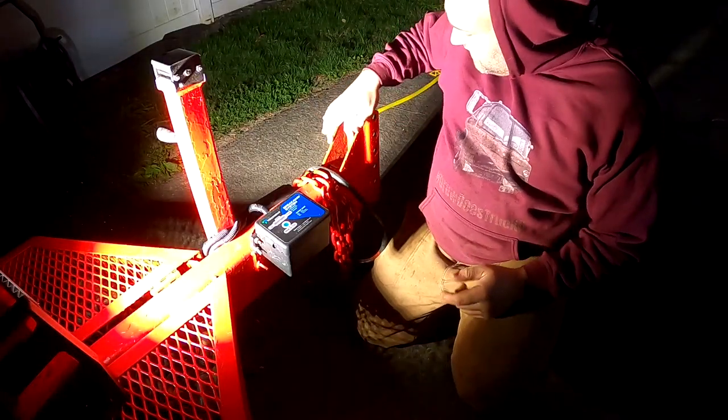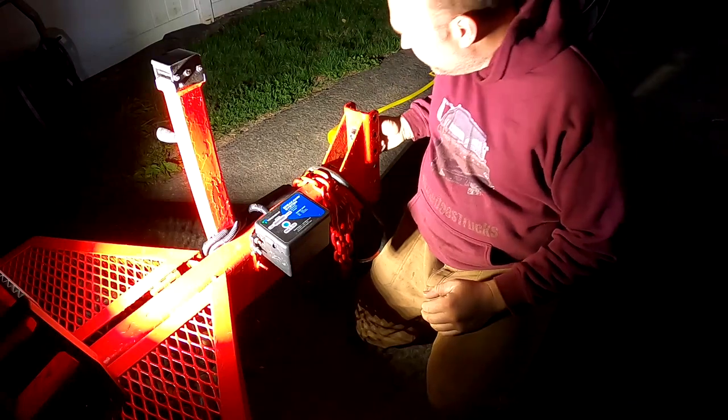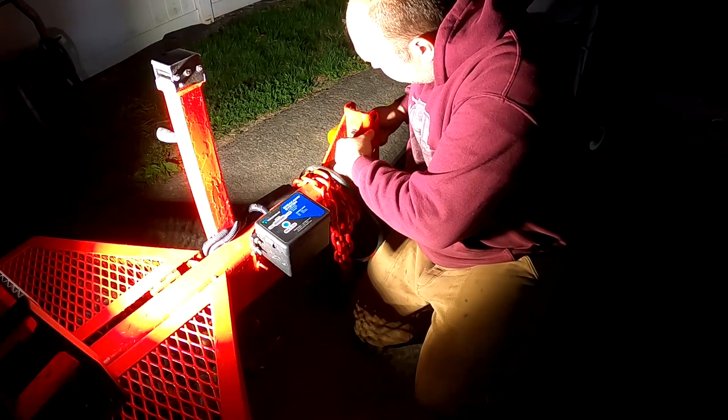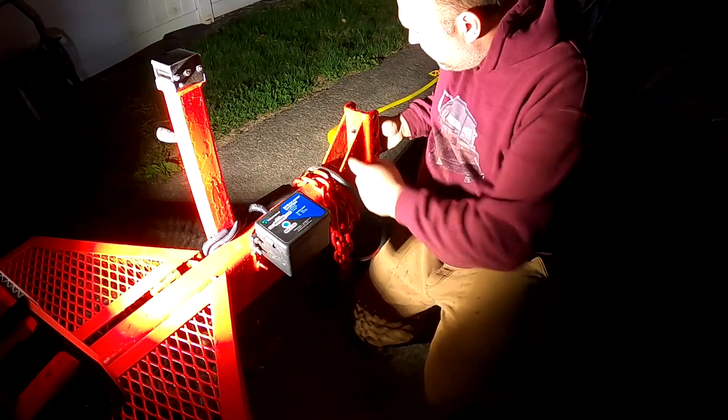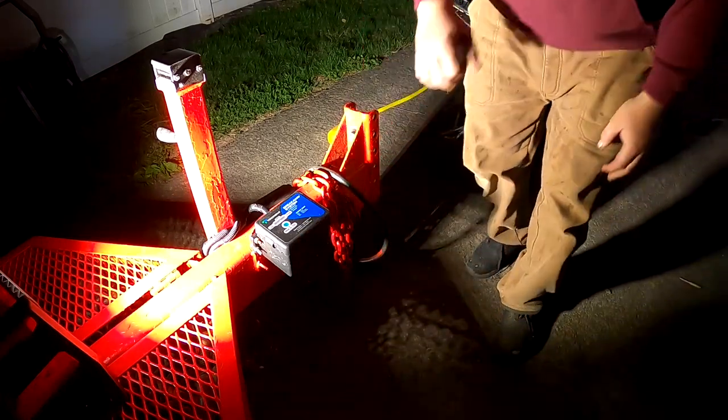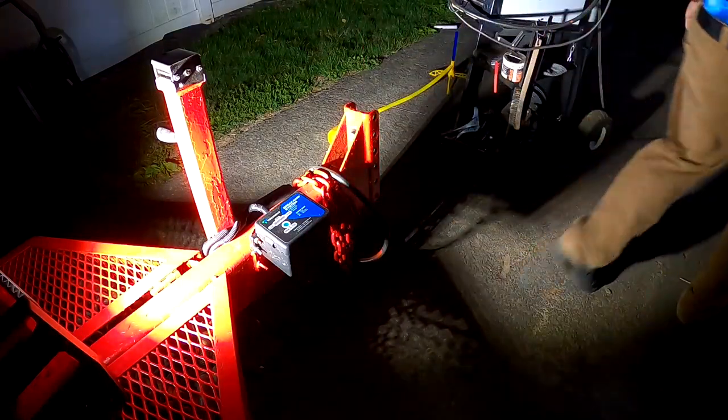All right, things happened. I got busy, it's nighttime, and I want to finish welding this so that we can put our coupler back on. I don't want to run the bolt any further out so it doesn't get any spatter on it. So I'm going to have to put a pair of pliers on the back side of it, and then we are going to weld that up.